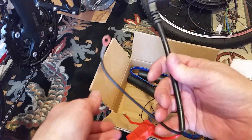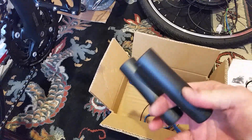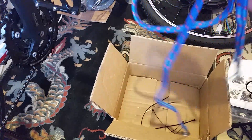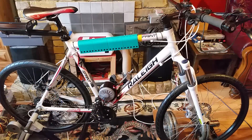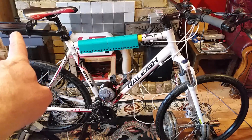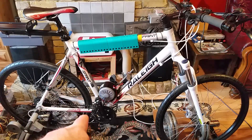There's the wire that connects to the battery pack - the terminals connect your battery and the controller plugs in there. I've got handlebar grips which I won't be using, some cable ties, and a bungee cord thing I'm not sure what it's meant for - it's not mentioned in the instructions either. The order I intend to follow: fit the front wheel first because if that doesn't fit there's no point doing anything else. Then mount the controller on the back rack with M4 screws and nuts, fit items on the handlebars, and finally fit the cadence sensor.